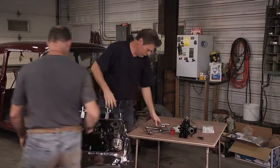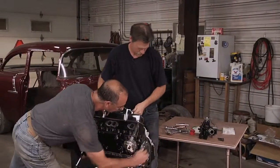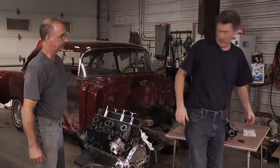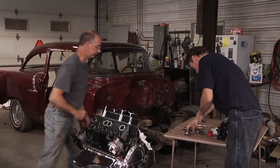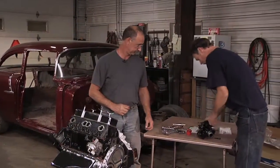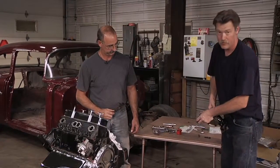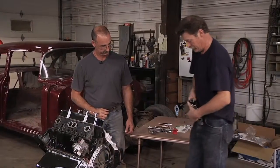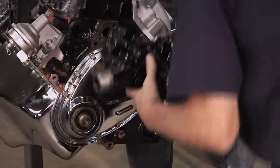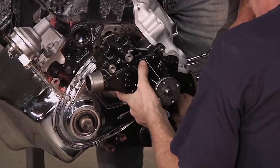Let's do-si-do a little bit so we can get a good look at the front. Water pump. And that's a pretty darn easy one — four bolts, two gaskets, one water pump. Sometimes there are things that get attached to water pumps on these bolts, but in this particular case there are not. So we're just going to put that in.